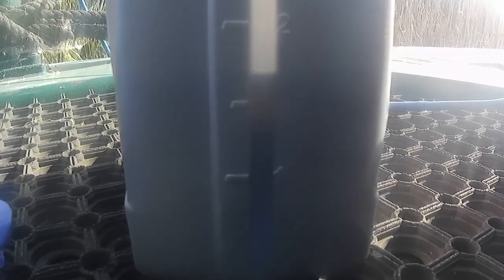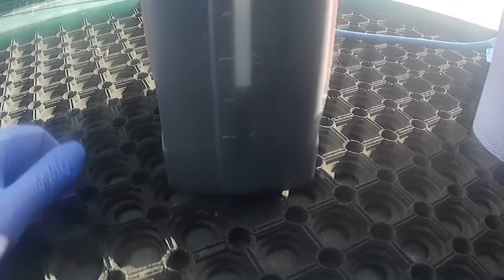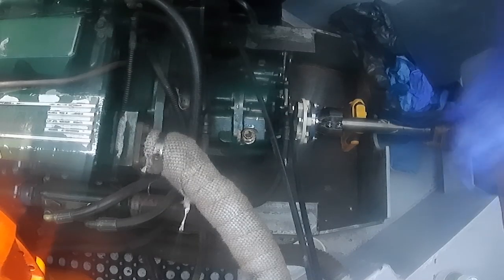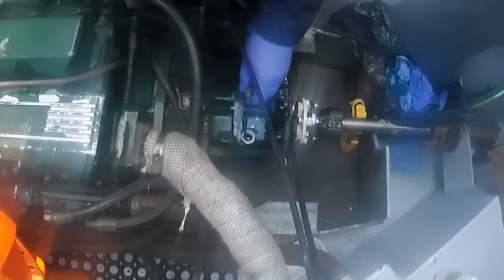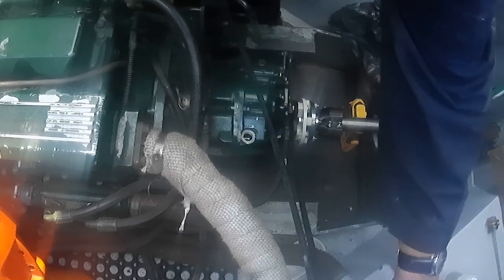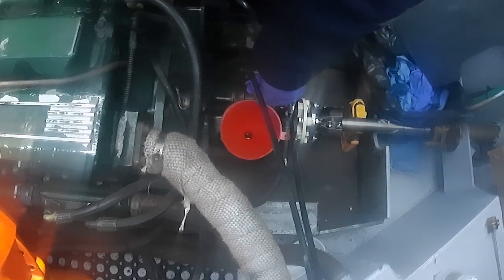Looking at what I got out, you can see it's about just over one and a half liters. It's supposed to be 1.4 liters or two and a half pints, so it's a little bit more. I just need to pop the same back in — take the dipstick out again, I put that back in just so I didn't drop anything in the hole while I was working. Just pop a funnel in and measure out the oil to go back in.